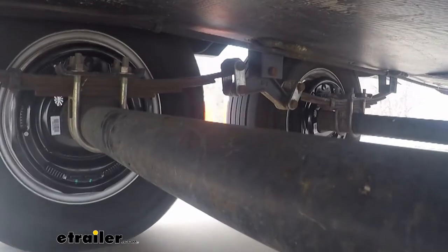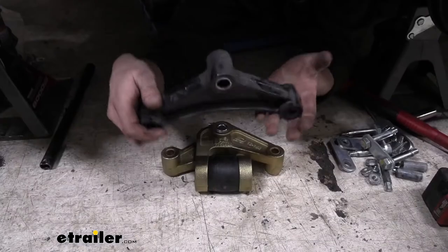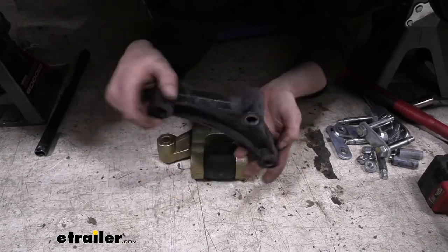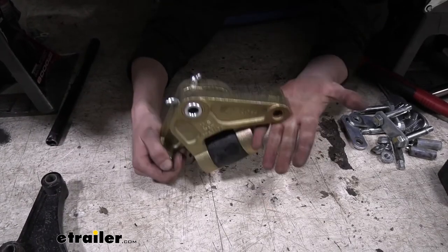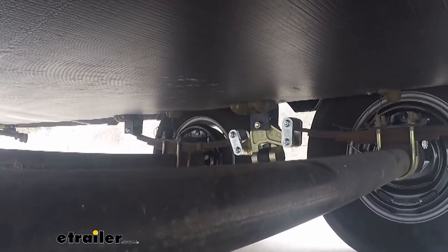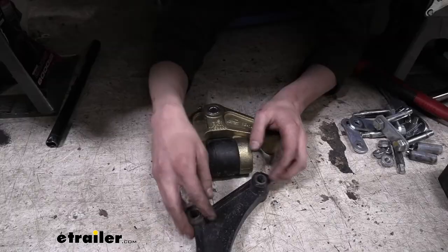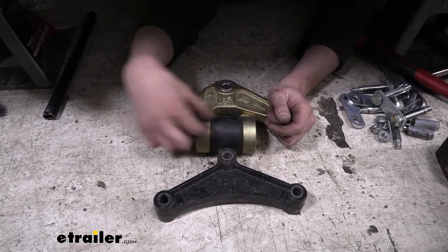The previous one is just solid metal. So if you're going down the road and your front axle hits a bump, it goes up — and that causes the other side to pivot downward. All the force going into one axle gets transferred through into your other axle and vice versa. With the new one, you can see a split in the middle — when the front axle hits a bump, it twists and pushes the force into the dampener. Any excess force that wasn't dampened then gets transferred to the other one, greatly reducing vibration from the road.